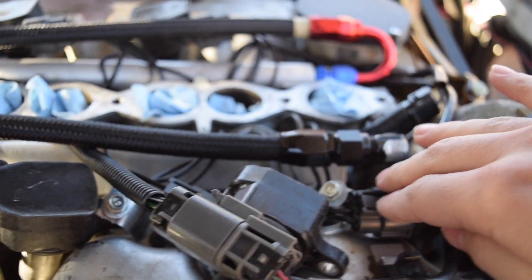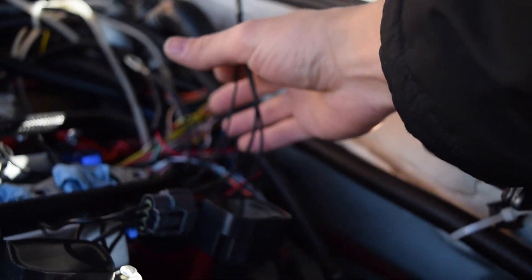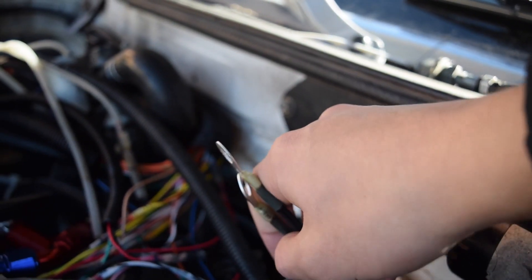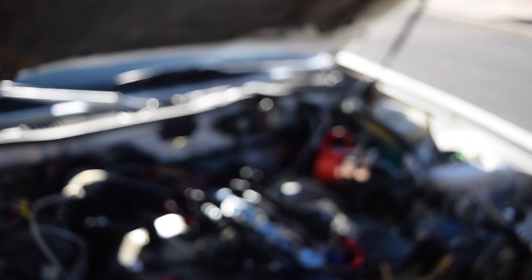For the ground for all of these, all the grounds — you can see there's one wire for each coil — they all come up and are going to be grounded to our intake manifold right up over here. You want to go ahead and ground these to a separate spot from where you're grounding your ECU and all of the ECU grounds, because these are a little bit of a noisy ground and can actually mess up the ECU. So those are going to be grounding to our upper intake.